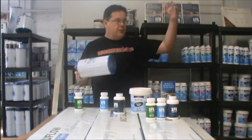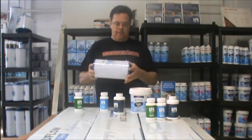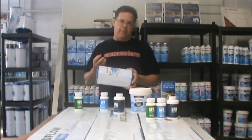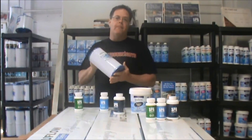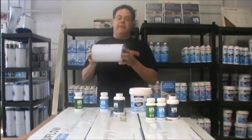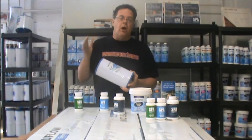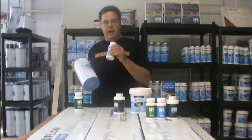You don't get a lot of debris in your tub because the cover's on it most of the time. It's not the dirt and debris you're worried about — it's the organics blocking the filter media. It's a porous material and water is drawn through it by the pump. If you have organics in it, it's harder for the water to draw through. So if your pump works at 2,000 RPM under optimum circumstances, if you don't clean your filter for a month, she's working at 2,100, 2,200 — higher than it should be. Clean your filters; it gives longevity to your spa. It's like the oil change on a car.